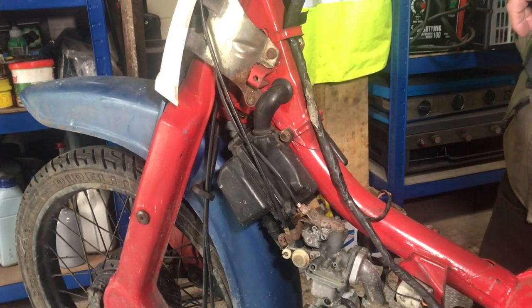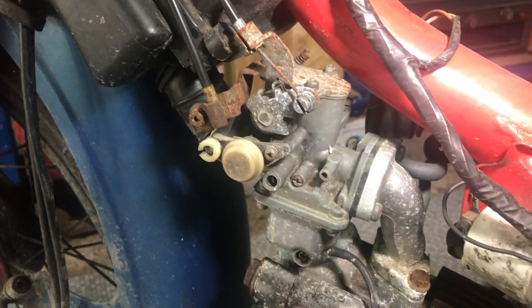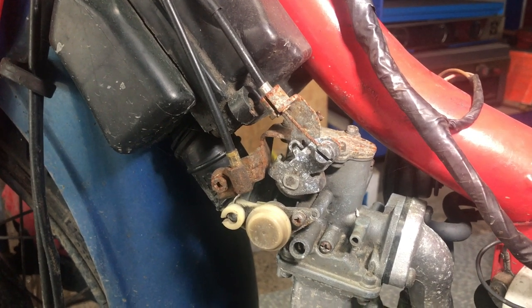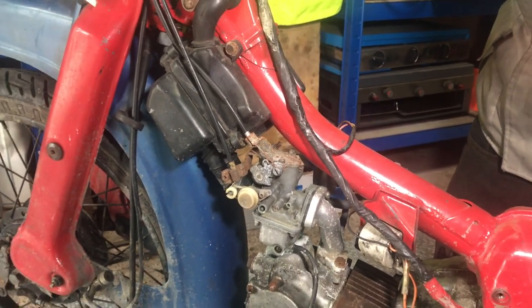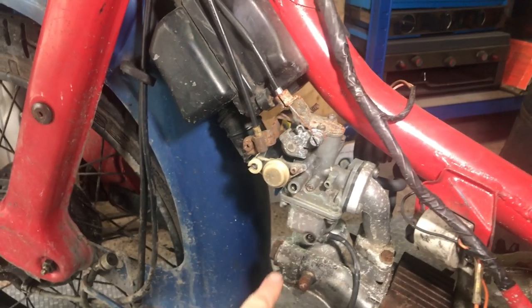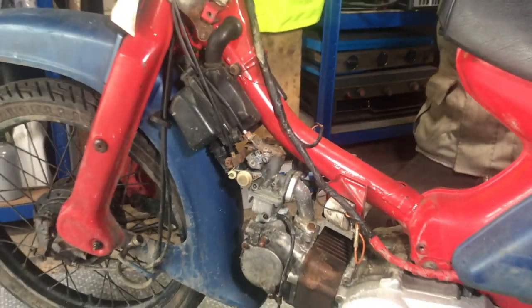Now we've got the skirt off you can see underneath what we've got, and the carburettor is there looking a little bit on the crusty side. The throttle return action is smooth and silky. The barrel itself looks a little bit on the rusty side — patina, I think they call it. But it's all basically there, so that's good news. We'll have a look in the airbox to see what the filter looks like, have a look inside the carburettor, check we've got some oil, maybe check the valve clearances, and then we'll see how we feel about starting it.